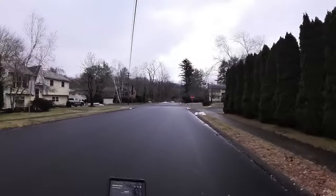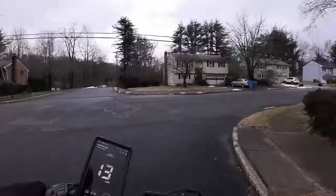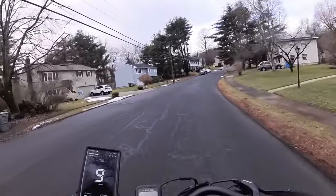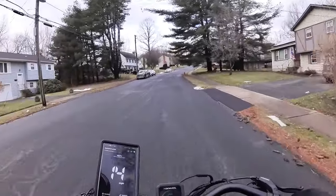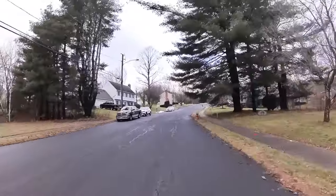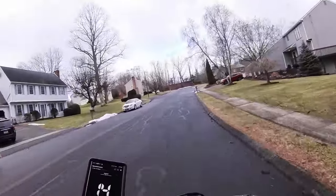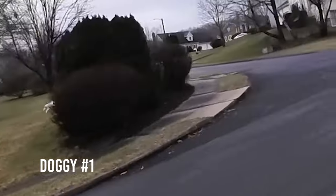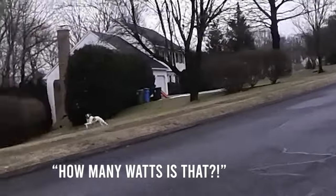They just take a little bit more maintenance than hydraulic brakes because, I'm out of breath. Because as mechanical brakes wear out, it's up to you to adjust them to make sure they work properly, versus hydraulic brakes. They self-adjust. So all you have to do is replace the pads. You don't have to turn any kind of Allen bolt like you do with mechanical brakes.